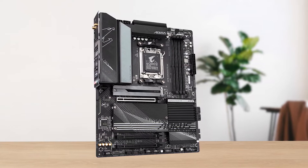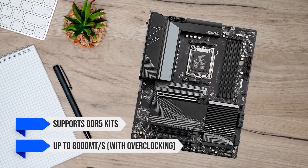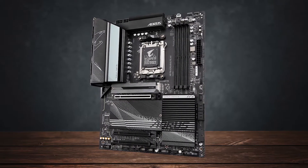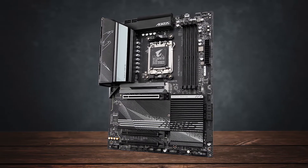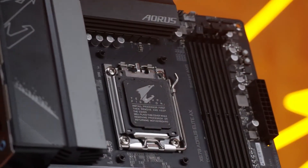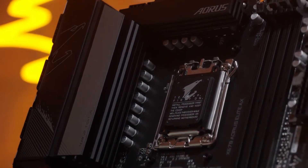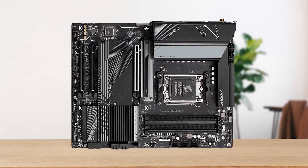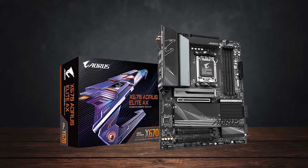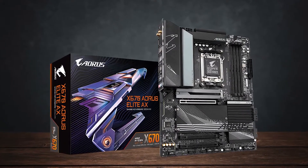In terms of performance, this motherboard is no slouch. It supports DDR5 kits at up to 8,000 megatransfers per second with overclocking, so you won't have trouble with high-performance RAM kits. Memory training times are great and boot times are solid. I also found the 20-phase VRM setup to be highly impressive — admittedly quite overkill for any mainstream motherboard, especially considering it's stronger than many X870 boards. However, I can't complain when we're getting such incredible stability for a cheap price.